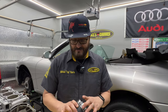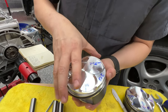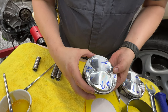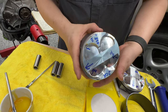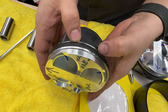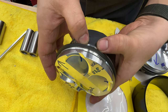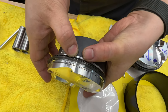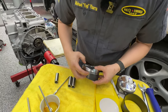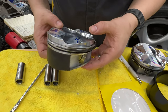You can see I got it all ready to go. I'm going to re-index it here to make sure everything is where it should be. CR for me is the second compression ring. The top compression ring and the oil expansion ring - I couldn't see the blue paint so I made my own little mark. But basically what you're looking for is to make sure the ring is not overlapped - and I can actually see it butted together right there. Alright, everything looks good. Now I want to make sure that my bottom oil ring is in the index, and it is.